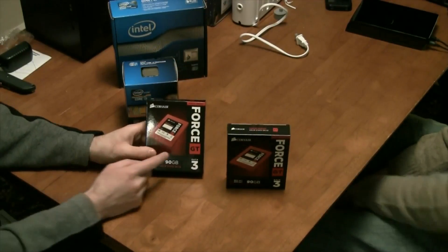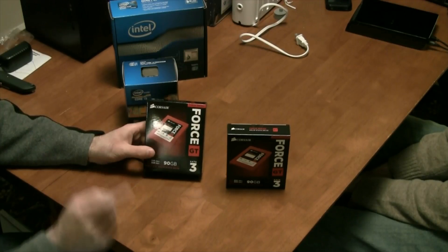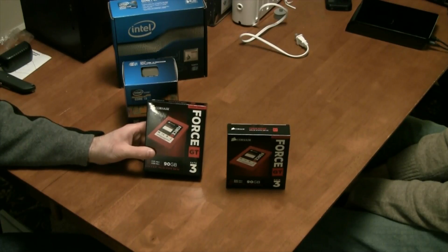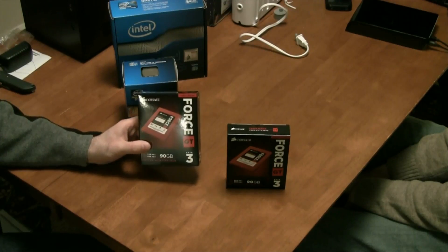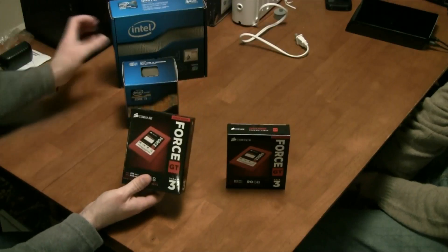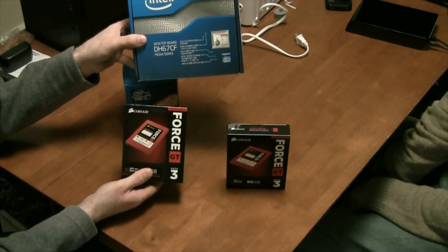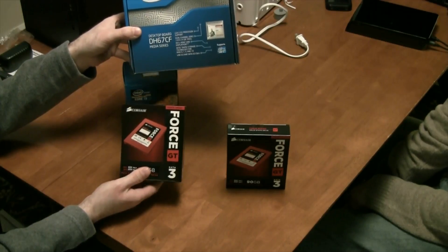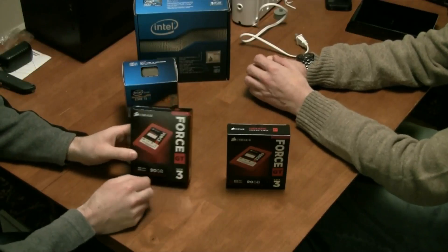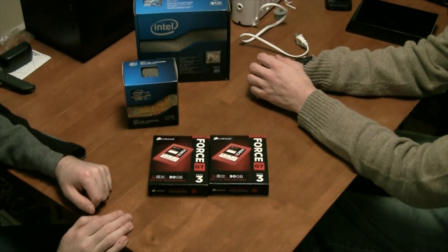We're using Corsair Force GTs. It's important to note that these Force GTs are actually synchronous SSDs as opposed to asynchronous SSDs. The cheaper SSDs are generally asynchronous and have anywhere from 25 to 40% slower write times than their synchronous counterparts. So they're not really the ideal primary SSD. This motherboard is specifically being used because of SATA-3 and RAID technology so that we can use two of these drives in a stripe situation — RAID-0 — and try to get this 555 megabytes per second up to over a gigabyte per second of transfer. We'll be happy with 500 compared to the existing hard drives in the old computer. She's going to be fast.